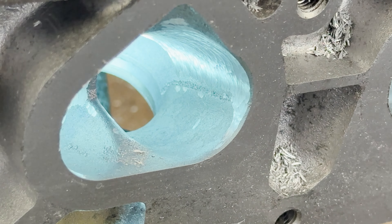Here's the other thing you need to consider: I'm using a burr that matches the shape. Wherever I go, like that radius right there, it follows the shape — and you're making the shape with the shape of the burr. It's super important that you get the correct size. A lot of guys go to too small of a burr and then they have to recreate the shape, which is really hard. This burr takes out so much material so quickly and it is already the shape, so it just makes the process a lot easier and more consistent.